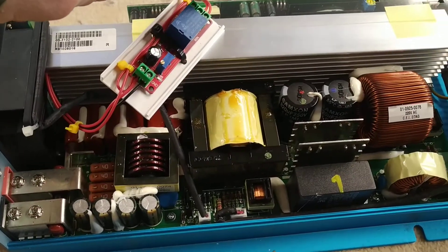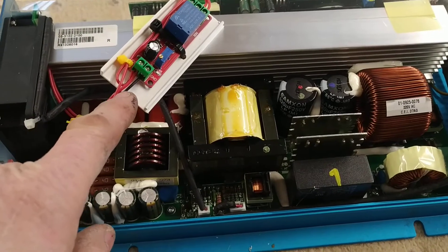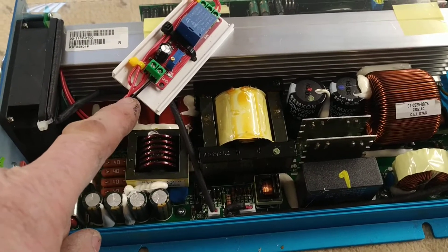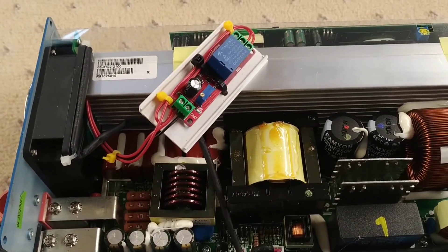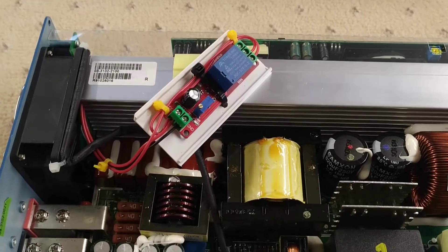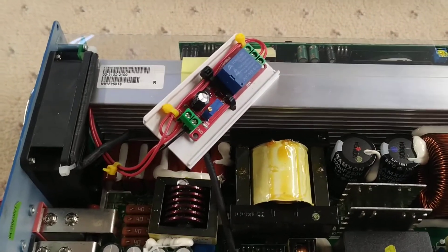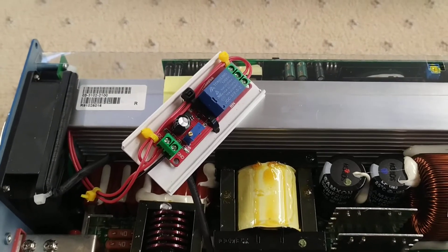There is a link wire I put from 12 volts to the common of the relay, and the ground wire is simply the ground wire that goes to the fan, connected in parallel with the existing ground wire. So the end result is you're just breaking the 12 volt feed to the fan, sticking it through this timer.